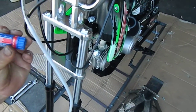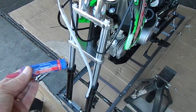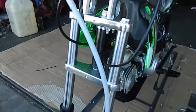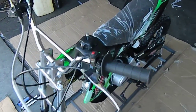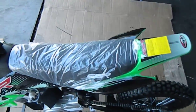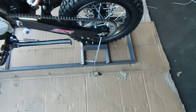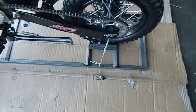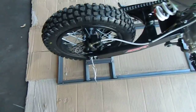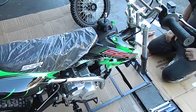We still throw a bunch of Loctite on those things — we buy the big tubes of Permatex Loctite. We use the red here, not the blue. So those four nuts that come in your manual go in there. Now when we de-crate this thing, we actually want it to stand upright so we can check the oil properly at the perfect oil level. Do yourself a favor and don't remove the tie-downs on the rear wheel — they keep the bike upright and make everything less labor intensive.